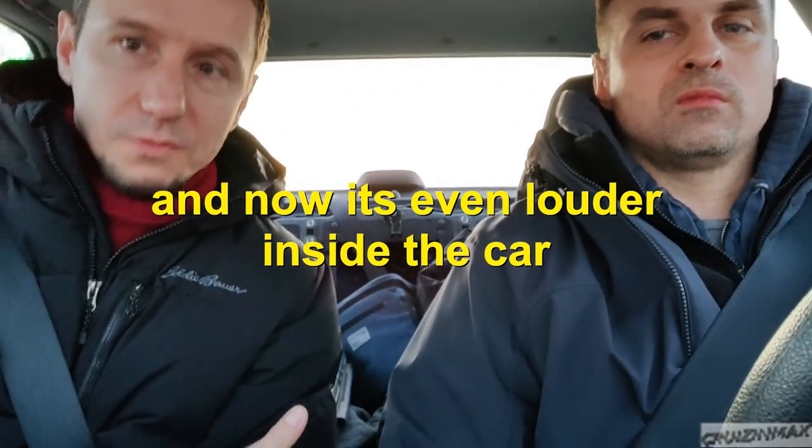Hey guys, we're going to Autocross number 2. We had two small issues. A wheel bearing, which was an existing issue from before, probably caused by the accident. A premature bearing failure. And we had a little knock coming from the rear, and we thought it was ice, a quiet rattle, but it turned out that the top nut on the strut tower came loose. So we took the seats off, and we never put them back because now we have more room for tires, tools, stuff like that. So that's why we don't have the two crates we had before.